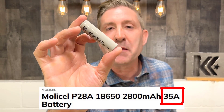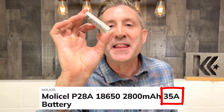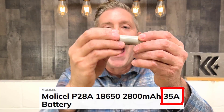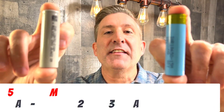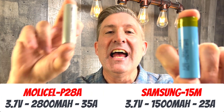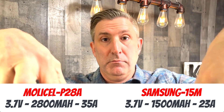The third number that really matters is the CDR, which is the discharge rate, measured in amps — basically how quickly can that battery let off the energy. A good way to wrap up this technical stuff is to put the specs of each of these batteries right down below. Over here I have the stock Milwaukee battery, and this is the brand new cell I'm going to put in the pack.